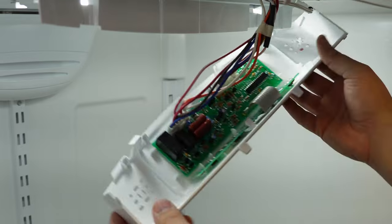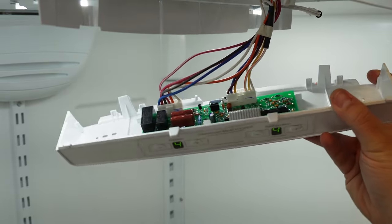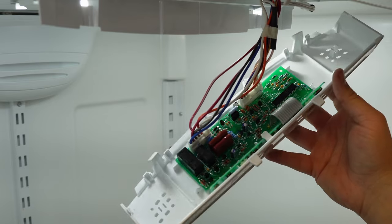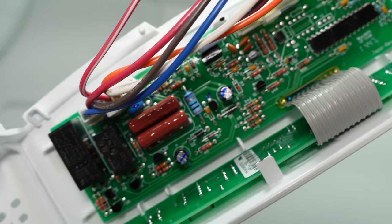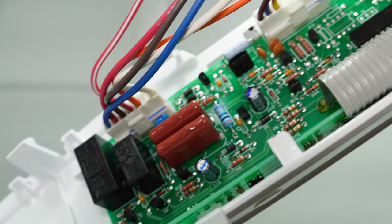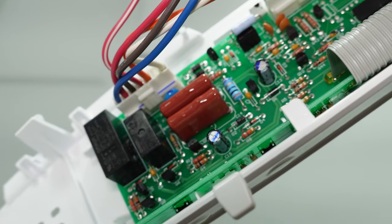Note that the refrigerator is still actually plugged in at this point. You can do voltage or resistance tests on the refrigerator wires to troubleshoot potential issues using a multimeter with very small leads. I would suggest purchasing a multimeter if you don't have one, as it allows you to do different checks — for example, testing the defroster without having to get into the freezer, since you can troubleshoot from the board. I'll include a link to a multimeter in the description and a product tag as well.